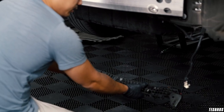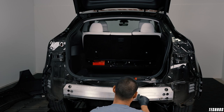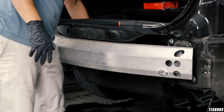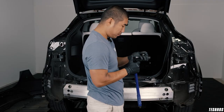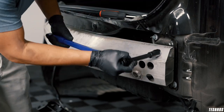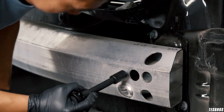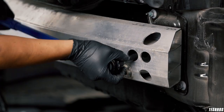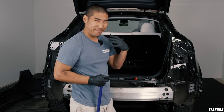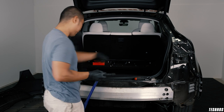I would just leave it on and just don't drop it — just let it sit like that. There's also a bracket right here, which we call the crash bar on the back. It's held by three 15-millimeter bolts and you do need an extender. Just so you guys know, this is actually 38 pounds. It's not that heavy, so you don't need that much force. That's going to be the spec that we tighten this back up to.